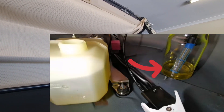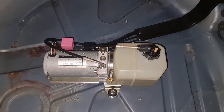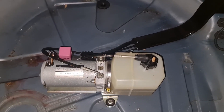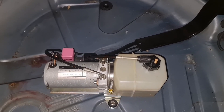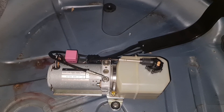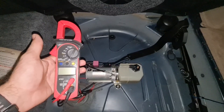As you can see in the video, the fluid keeps coming back to the container with the roof stopping in one process. As I mentioned, if we keep getting fluid back in the container, that means we have an internal leak or bypass in the system — the most probable cylinder in this example is the bow cylinder. If the return of fluid into the container stops at one point, that means the pump does not have enough pressure to lift one of the cylinders.